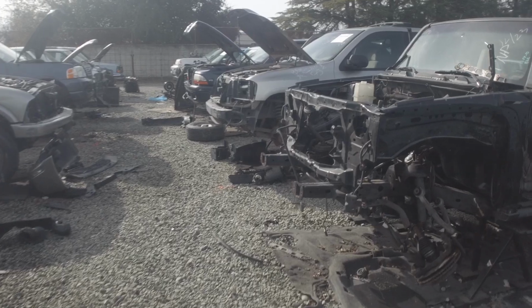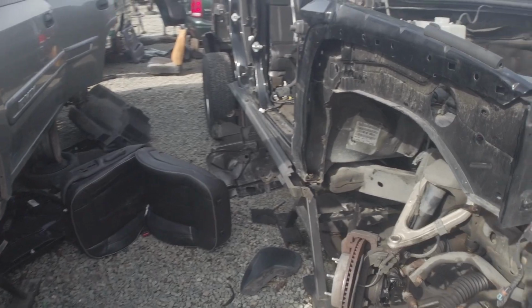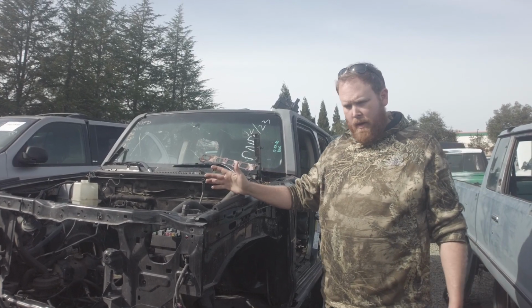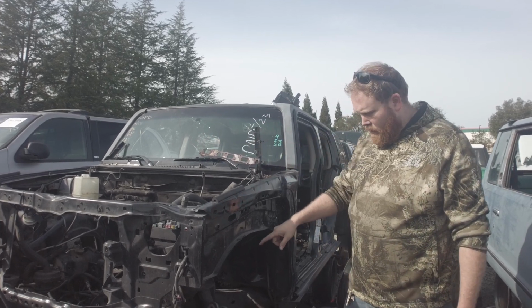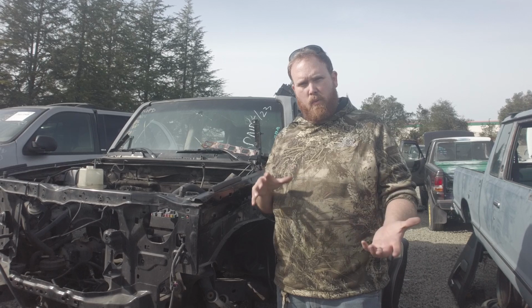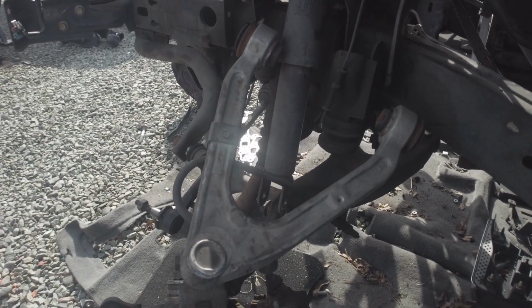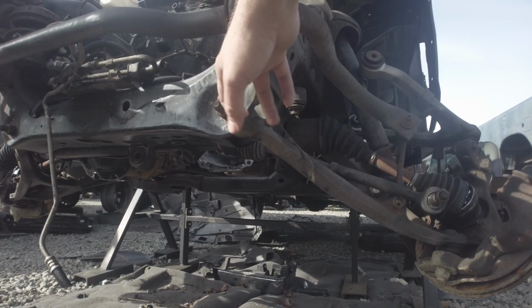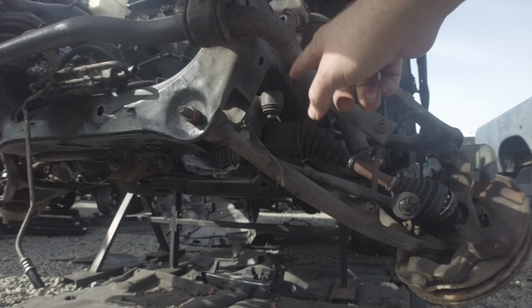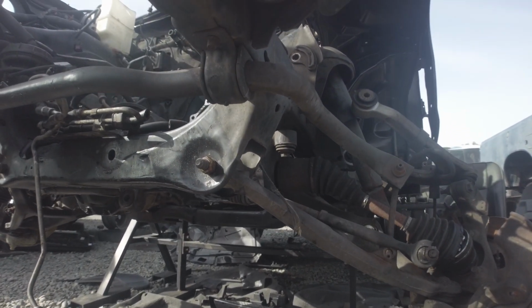All right. It's all still here. So, last week, Zach and I were here and pulled out the motor. And what I wanted to do was pull out the suspension to show you guys how to swap this suspension into your Chevy Colorado. Essentially, everything from the bolts out will swap over into a torsion bar four-wheel drive Z71 Colorado. So pretty much from the pivot bolt out, including the bolts. The rear pivot bolt is actually longer on the H3, so you want to grab that as well when you do this swap.